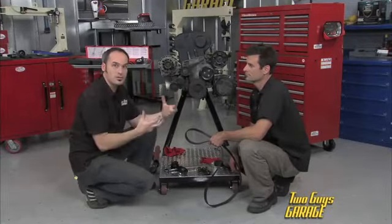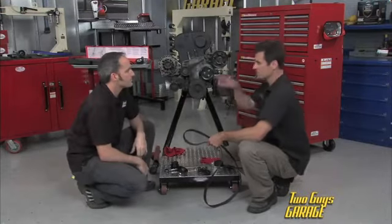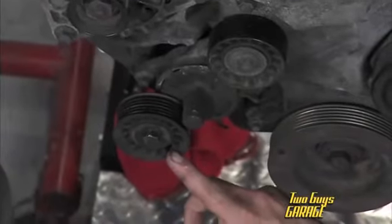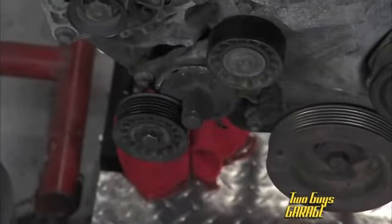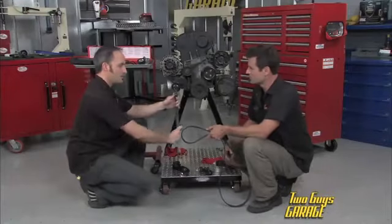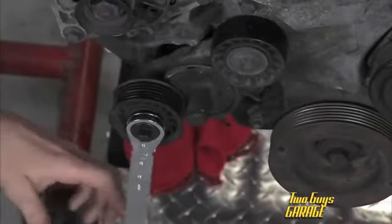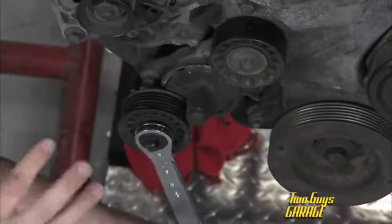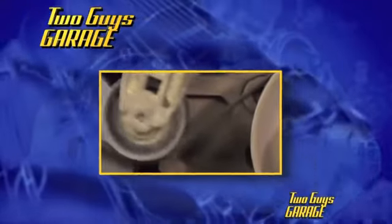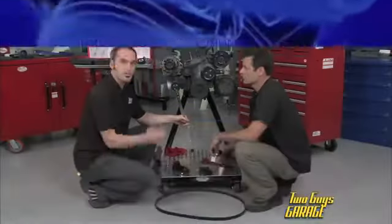And that's why as a system, they've got to be designed right, and you've got to maintain them right. Yeah, it's hard to keep that tension on every single one of these surfaces with this one little tensioner. And that tensioner takes a lot of strength. I mean, if you put this wrench on it, show them how much leverage it takes just to move it. Now here's a really long lever arm, but still I can feel how much load is on there. That tension has to be critical over time. So it may be fresh in the beginning, but as the system wears and as that spring starts to fatigue, that's an important item that you want to replace as you replace your belt.